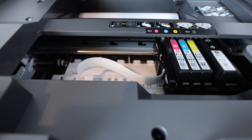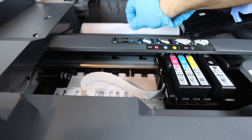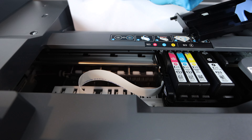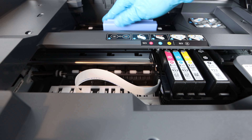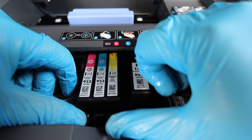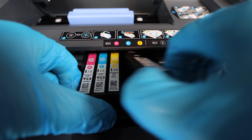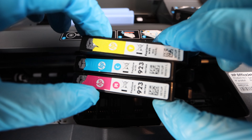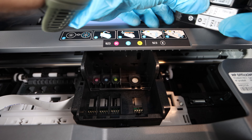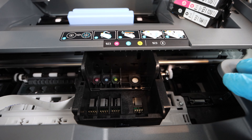You're going to print off another report and then unplug the printer. That's going to cause the print head to be centered and unlocked — the most important thing is for it to be unlocked. Pull out the paper that was about to be printed on, and then remove the ink cartridges. The ink cartridges may have some ink or may be dried out. Sometimes the system shows them as full or halfway when they're actually dry in reality, so you have to do a manual check.